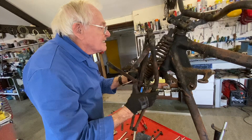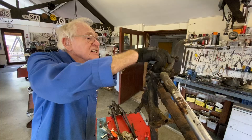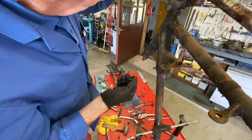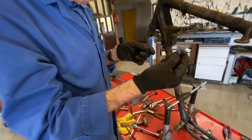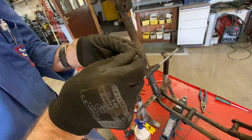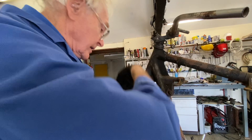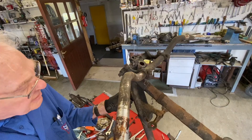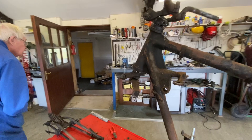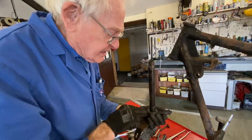The spindles don't feel too bad — often you get a lot of wear on these which means you've got to put new bushes in them. I'll just drop the yokes out — chrome plated job, that one. No washer, which is strange. So we drop that out — that's the clamp bolt that clamps the job together. You can see there's a little spot on there that locks it into the yoke to stop it spinning. So theoretically that should drop out of there — copper mallet again. Ball bearings starting to fly out here — the only thing you need to do is retain some of the balls so you know what size they are. Pretty crude in there — it hasn't been very happy in there for a long time.